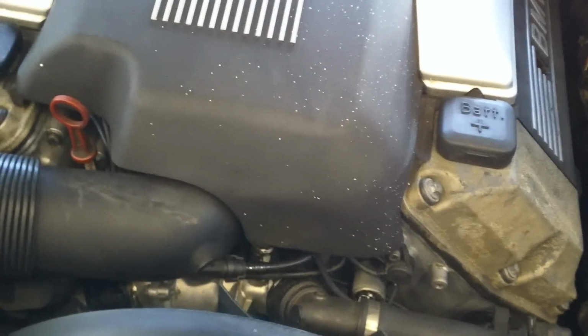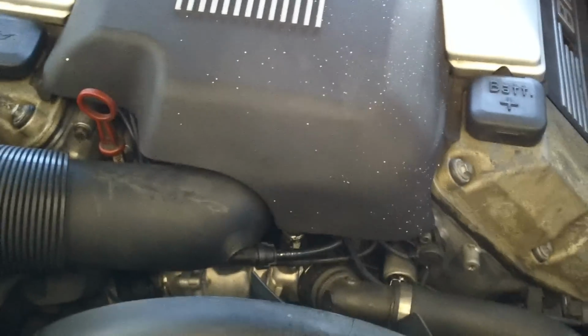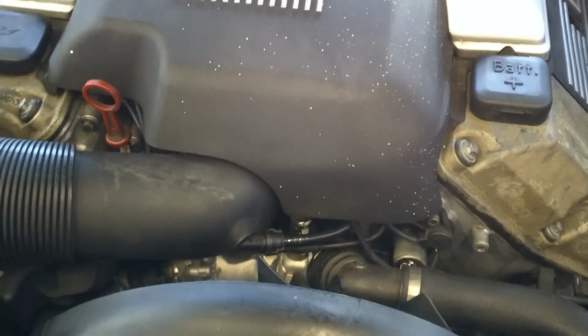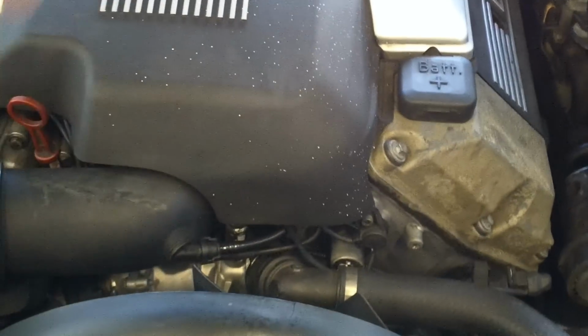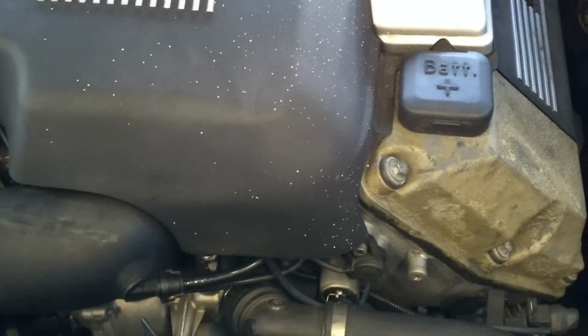but this is what you want to do: after you've got the cams locked down and timed where they need to be, like I showed you with the ohm meter, you go counterclockwise to the end stop, and you'll know because it'll make continuity when you check the resistance on the ohm meter. So that will beep. That's where you know your end stop is, and you're going to want to make sure that's tight in there.